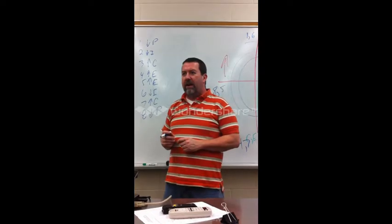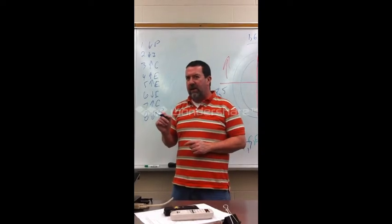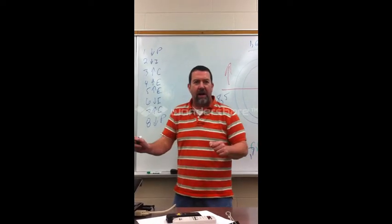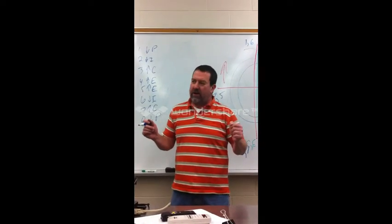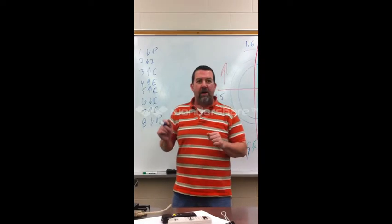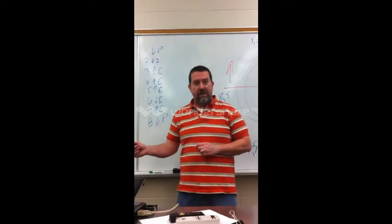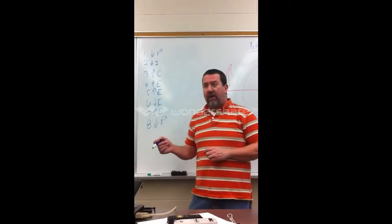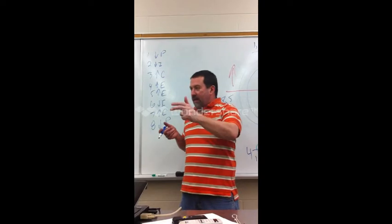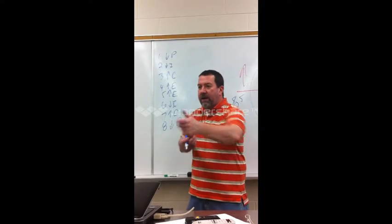What determines the firing order in an engine? A lot of people think that it's ignition. Okay, I can put the spark plug wires anywhere I want. Anybody ever done a tune-up and put the spark plug wires on the wrong spot? You made your own firing order. Does it work? Nope. Why not? It's when valve timing is working. What causes the valves to open and close? The camshaft. So the crankshaft determines mating cylinders, the camshaft determines our firing order. So what some people actually do is they'll have a low output 5-liter, buy a replacement camshaft that has the same firing order as the high output, and put it into their low output.